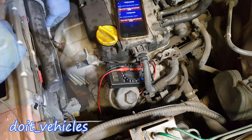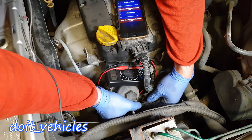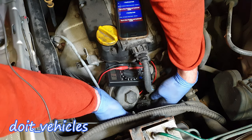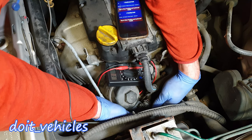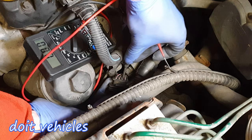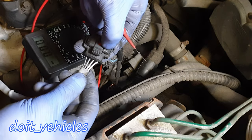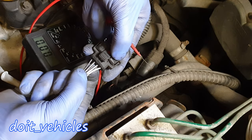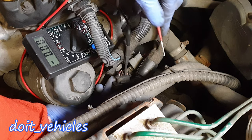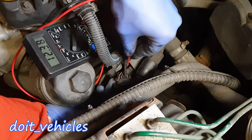Another thing you can do is inspect the wires at these points — usually they are very well protected by these covers. Now I'm going to have a look at the connector and see if it delivers 12 volts, which is good to know for further investigation. Down here I found the ground. You can also look on the sensor connector — the gray wire is the ground.